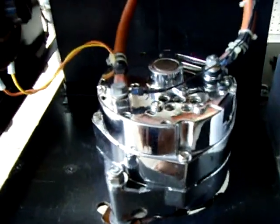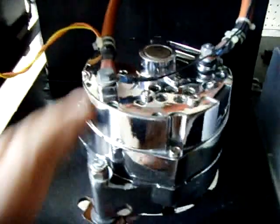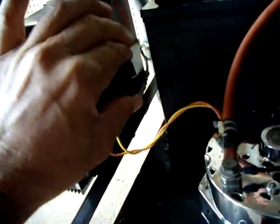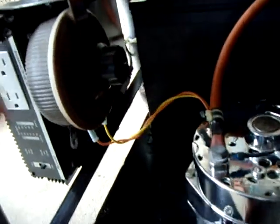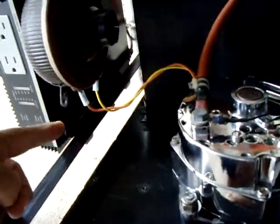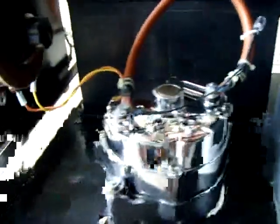Works perfectly. I can run a lot of things now that I really couldn't start before because the engine would stall. I can just turn it down, start the engine, turn on the load, it'll drop the engine a little bit, but once it gets past the surge just flick this back — boom, now you're on full power and you don't have any problems.